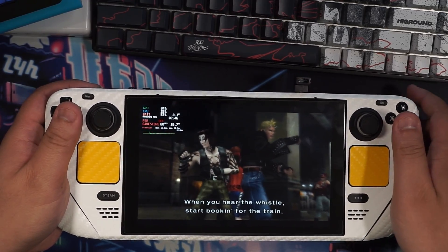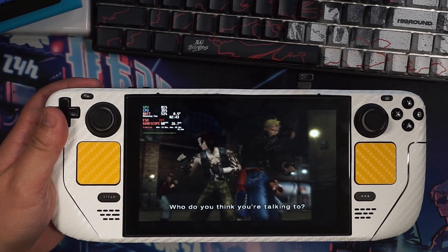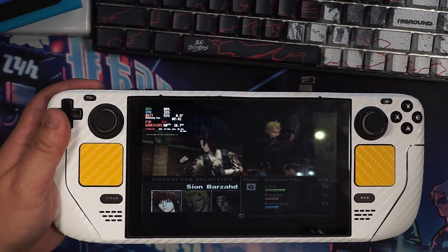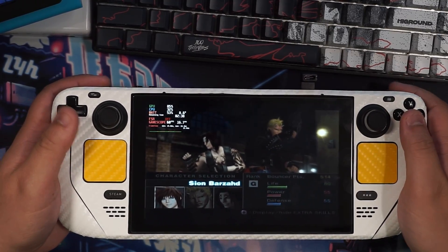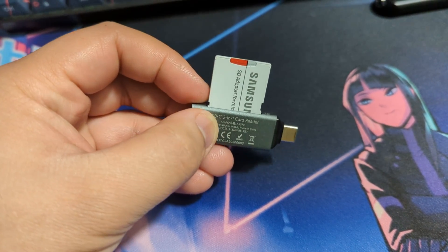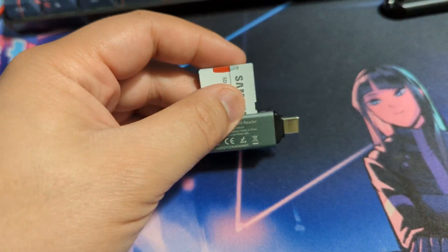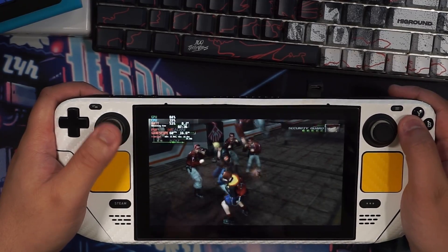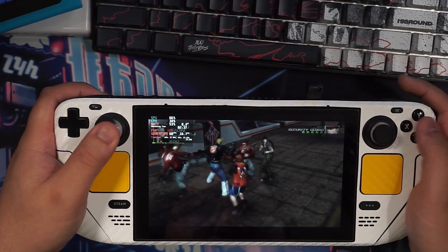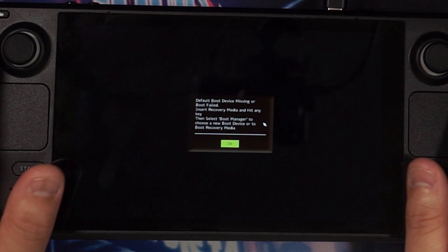Number four, you don't have to use USB flash drives. If you have any spare micro SD or SD cards with an available USB card reader, you can put the recovery SteamOS image on it as well. I ended up using a Samsung micro SD card with my Anker USB-C card reader after having troubles with my USB-C hub. My final tip is if you're having trouble getting into the UEFI boot menu, you can also just power up the Steam Deck normally — it will tell you that it cannot find an OS installed and will help you navigate to the boot manager window that way.